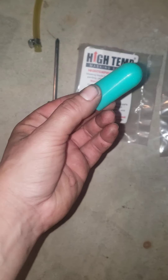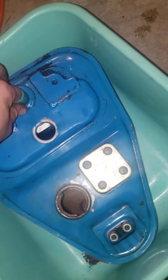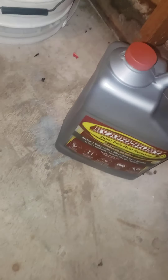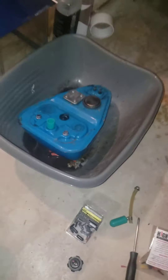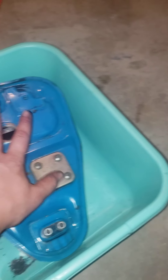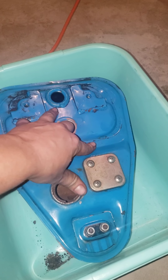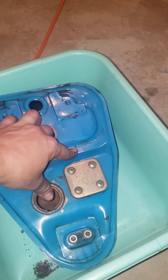And then this fatty here to plug that hole, just like on that one - now it's stuck on my finger. The final treatment is the Evapo-Rust. The way I'm going to try and do this: this tank will get flushed and put its second vinegar solution in, and this one is getting its first solution. When this one is ready for the Evapo-Rust, this one will be getting its second batch of the cheaper stuff in it to clean it.